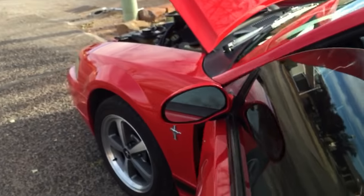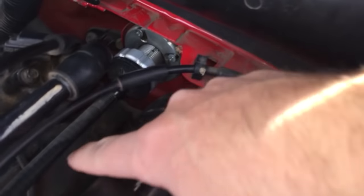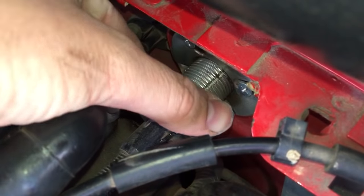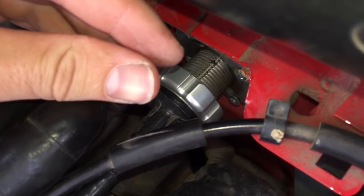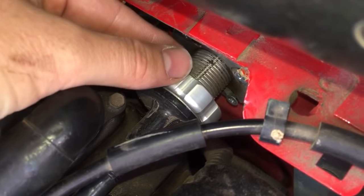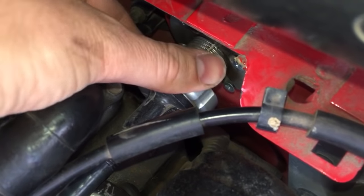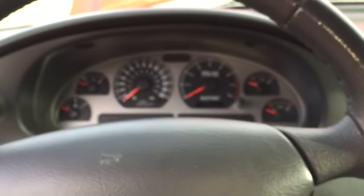So now I'll show you the firewall adjuster. Here's the clutch cable coming through and going in here. This is basically on a little wheel — as you turn it clockwise you're loosening the cable, and as you turn it counter-clockwise you're tightening the cable, giving the effect as if you're pushing the clutch in. I have it set up right now so you'll hear the infamous chirping that you're probably trying to avoid, and I'll show you how to adjust away from that.